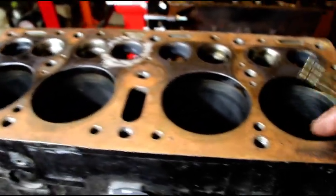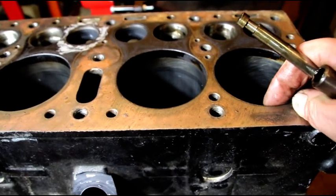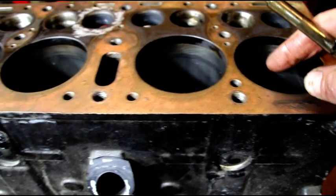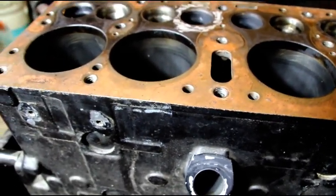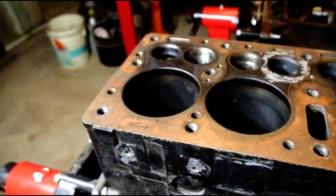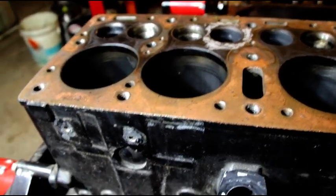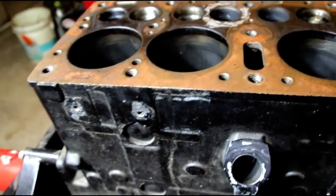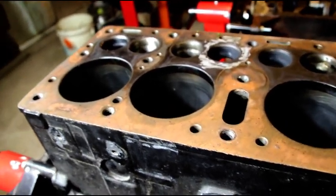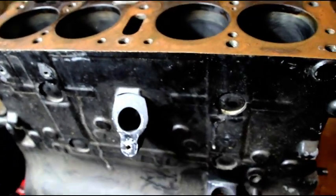The engine builder should have caught this. The bores aren't straight and true — they're 2 to 5 thousandths oversized. The pistons are scuffed and there's a lot of carbon buildup. I don't know what kind of ignition or carburetion was running, but it seems like it was constantly running with the choke on, given the amount of carbon in here.